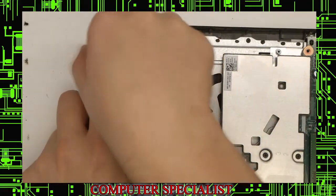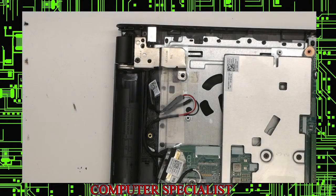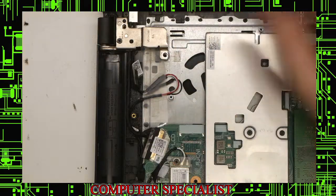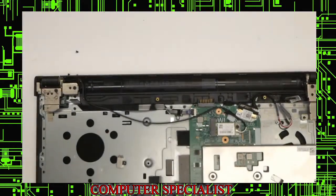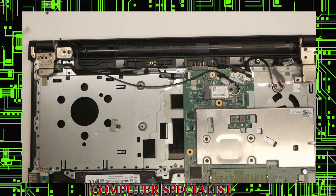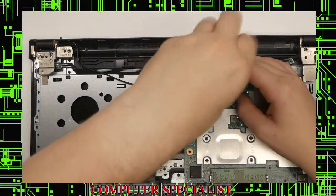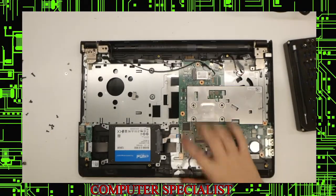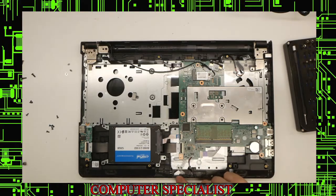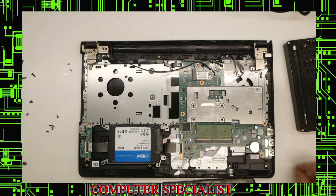Now that we've got that in, we can put the hinge back down and put the hinge screw back in — there was only one hinge screw here. Now we're pretty much done with the actual work part of it. We can reassemble the laptop and then we should be good to go. We'll start by putting the bottom back on. Before we do that, we'll put in the motherboard screw we took out. Make sure that the LED channel piece down here is still aligned and laying in there properly, which it is. Now we can put the bottom on and snap it in.